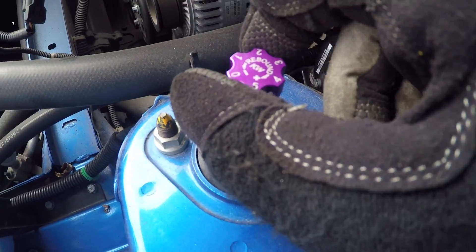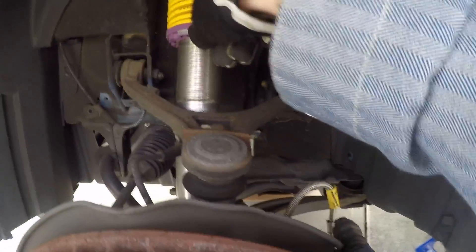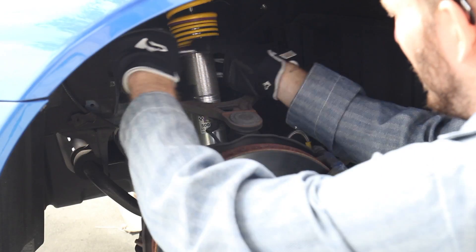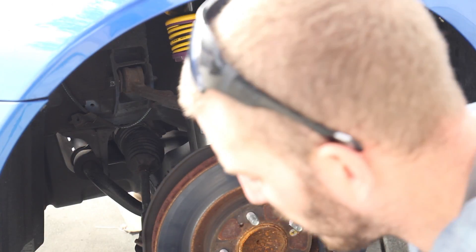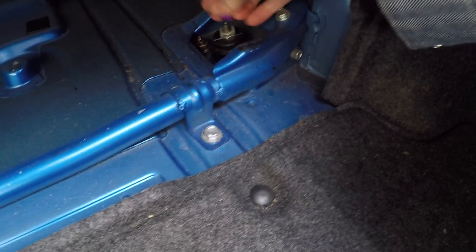Repeat the same step on the front left as you did on the front right — turn all the way to the right and then turn left seven times. I'm going here to loosen this up. That's what happens when you get too big of tires — because race car. I've got the technique down: load it up and put my hand completely around it. Maybe this one was just four turns, I think. It would make sense for corner balancing — this side would be a titch higher because that's the driver's side. Like the last coilover, I also adjusted the compression to seven.